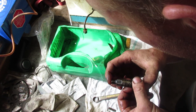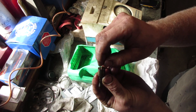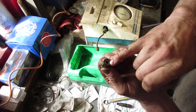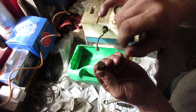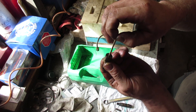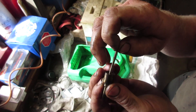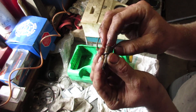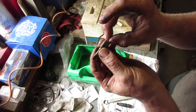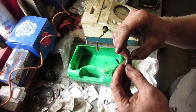The injector actually says right on it, 245 bar. So what's happening when you're spraying diesel is there's a spring that pushes on this nozzle, and there's about a thousandth's clearance all the way around. The injection pump sprays the fuel beside the injector nozzle, and it actually hits this part of the injector right there — just that little lip — and the pressure's enough to overcome the spring and lift the nozzle off the seat. When that happens, you've got holes and the diesel will spray out. As soon as it relieves that fuel pressure, the spring pushes the nozzle back down again and closes it.